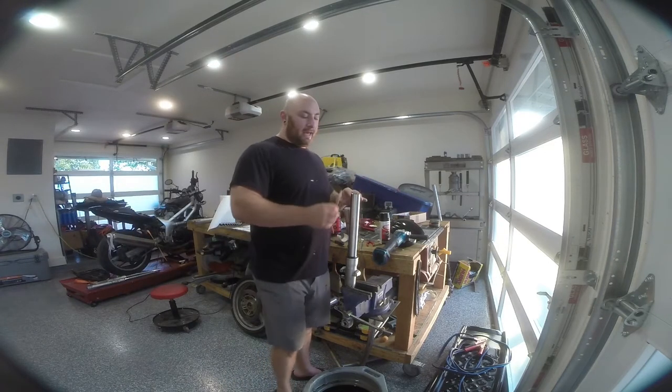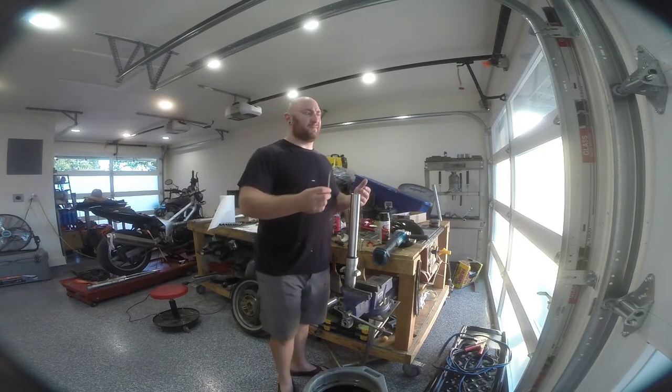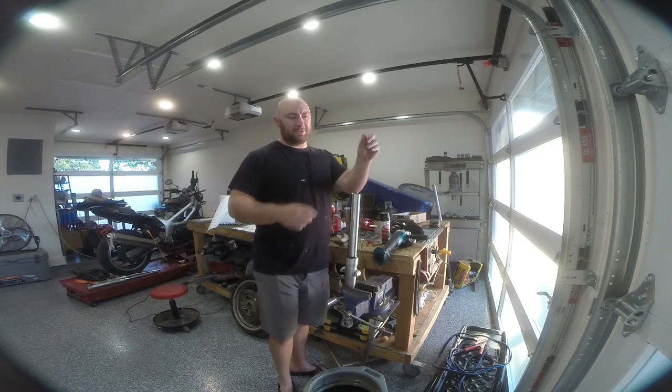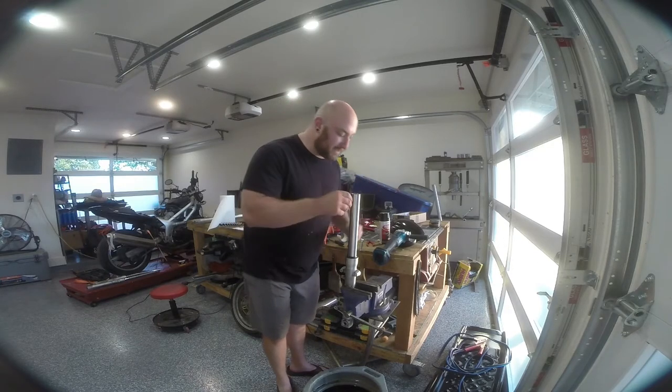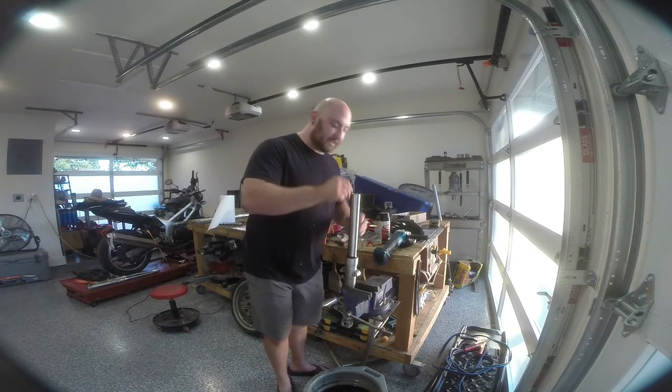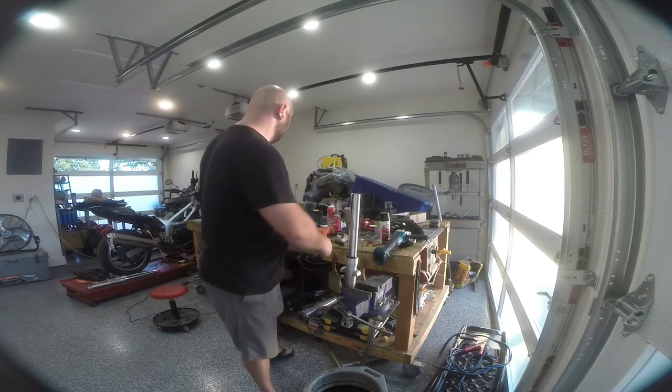Spring is in there, and the manual says 497 milliliters, I think, or 495 milliliters. The trick is 92 millimeters from the end of this to here. So this is our little dipstick, and it just goes down in the middle. And basically, whenever the fluid just touches the bottom of this guy, we know we're at the right fluid level.